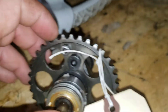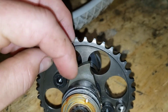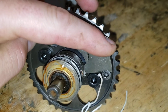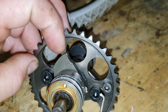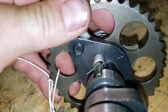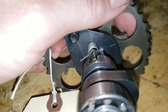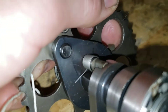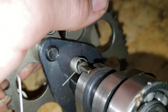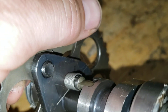Here's your lever. At rest, at low RPM, it looks like that - and then once it starts running, it swings out and hits that stop bolt, or the pressed-in stopper in the new style. As it spins up and the lever flings out, that little semi-circular piece on the left exhaust valve flips and it's flat - it doesn't protrude anymore. That's how the auto decomp works.